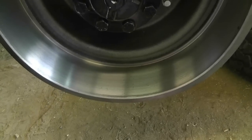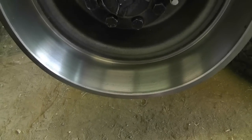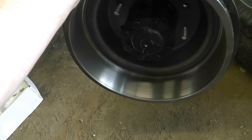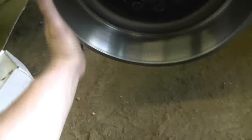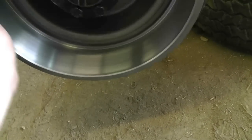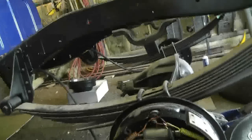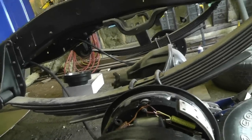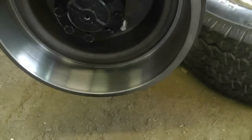It's not hanging up by a lot, but it's hanging up by enough. Next time I have to do brakes on this thing — hopefully many years from now — I'll deal with it properly. These drums will probably be very serviceable once they get turned down a bit and might not be as much of a hassle. I could take it to a brake shop and get them to cut a chamfer, but I can't be bothered. I might just rotate it by hand — I was thinking about driving something off the pinion, or using the air ratchet — but I think I'm just being silly going to that much trouble.